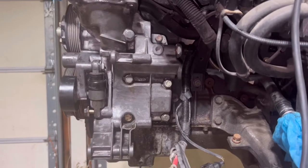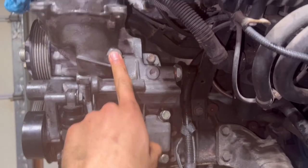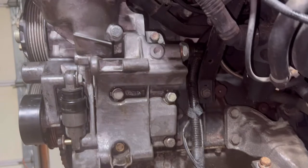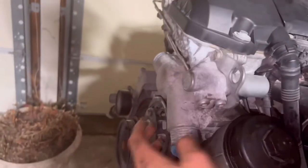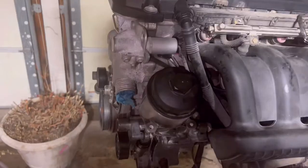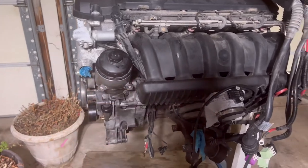So you guys can see I have all six bolts tightened up. I started here, did one diagonal, then here and here, just to give it a nice tight seal — basically a star pattern. New gasket is in. Eventually once everything is together, after I redo the valve cover gasket, head gasket, oil pan gasket, and also do the M50 manifold swap, I'll give the engine a nice hose down with degreaser to make it look all brand new again, and then we'll get her in the car.